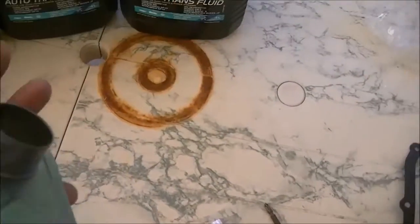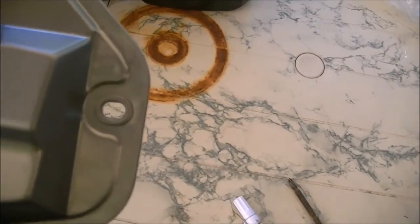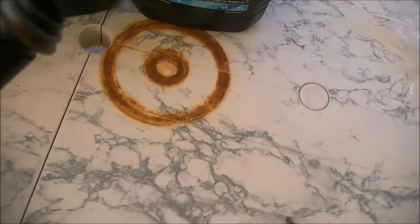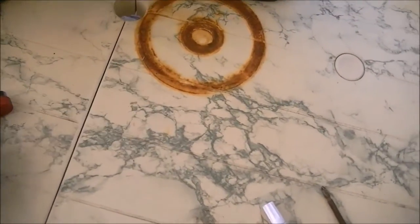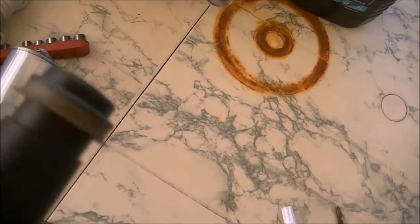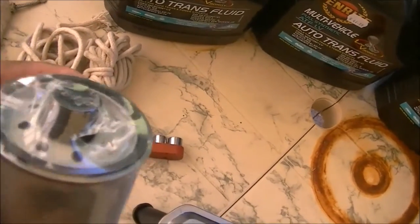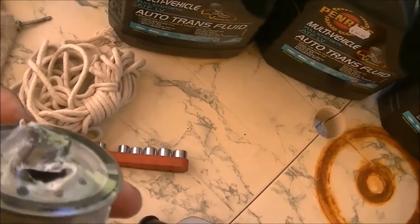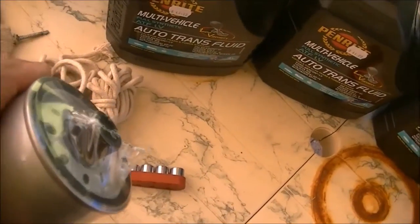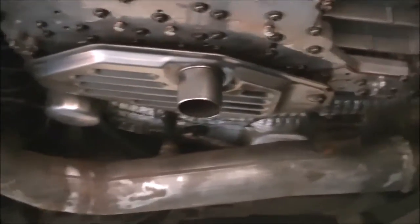Here is one of the filters, replacement one. There's a little mounting screw there and just a pop-on joint on that side. Always moisten these seals with oil before you push them on. And this is just a standard, not screw on but screw in filter. Let's remove them. We'll remove the big flat one first, and the reason being it'll give you more clearance to get to the round one later.